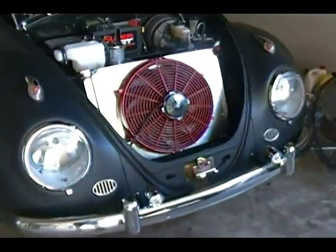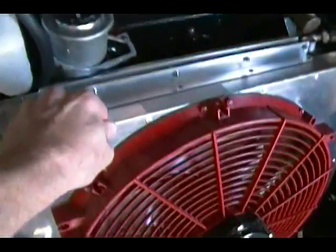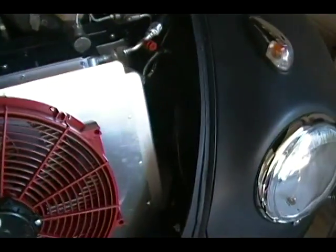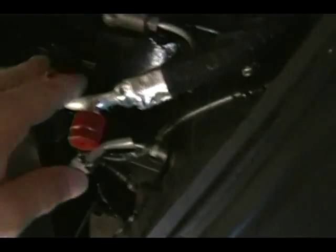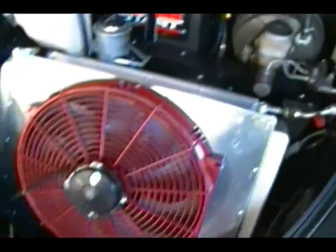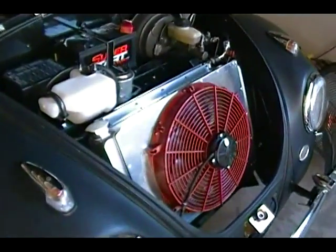Now I've got it all here together. I've got the radiator in and screwed down. I've got my overflow bottle back in, my power steering reservoir back in. I actually have my AC hose connected here — I've got to connect the AC hose down there, but that's the one that will hook up to the dryer. The dryer hose I have routed up through here, across and up into the air conditioner unit. Everything's bolted together, all the hoses are tight. I'm ready to put some fluid in it.